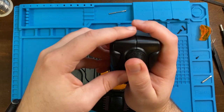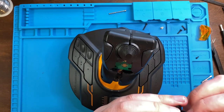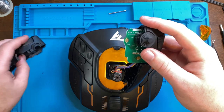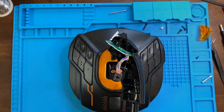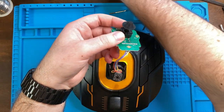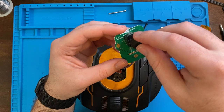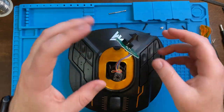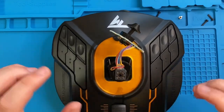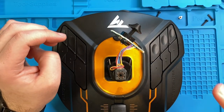We'll pull this apart, making sure not everything goes flying out because some of this is going to go with that. The rubber stops come with them, so let's not lose those. That comes out. This button over here we'll leave in because it doesn't easily come out, which is perfectly fine. We'll unlatch this side, and then we have the top hat. These three buttons are on the circuit board, and right here we have the potentiometer. We're going to need to desolder and unmount this, then replace it. I'll cover what we're replacing it with as soon as we get it desoldered.